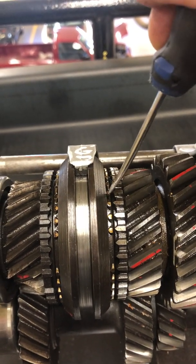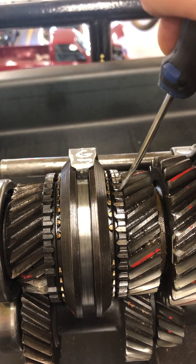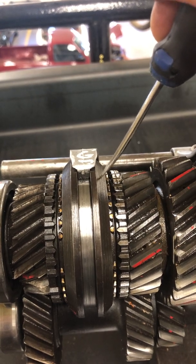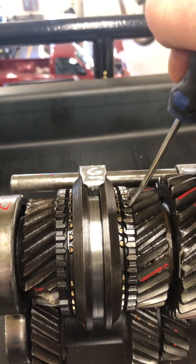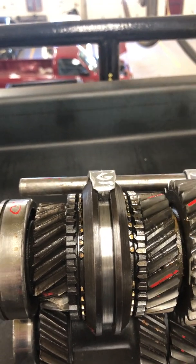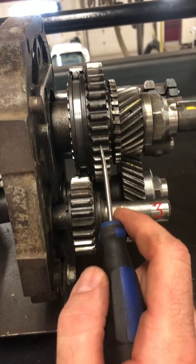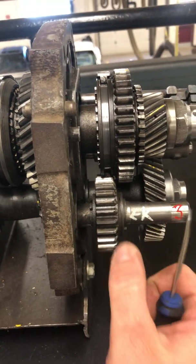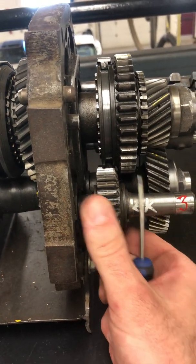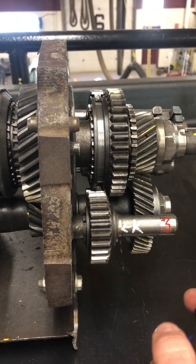You can see that these don't line up right now. The synchronizer works as a brake pad — when this gear is pushed this way, the synchronizer slows down this gear so the collars can match the same speed and you can shift into gear easily. This gear over here does not have synchronizers because it is the reverse gear — in this vehicle you have to be at a standstill to put it into reverse.